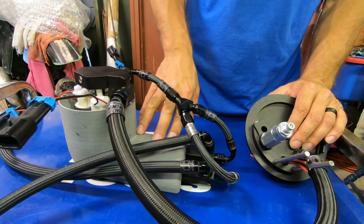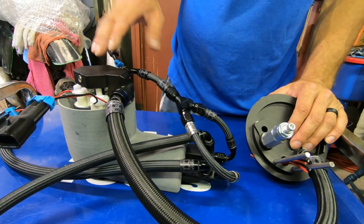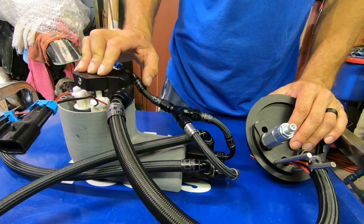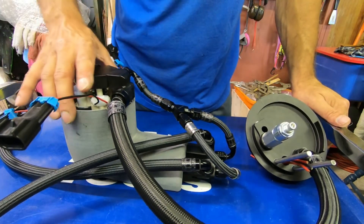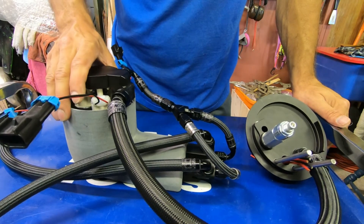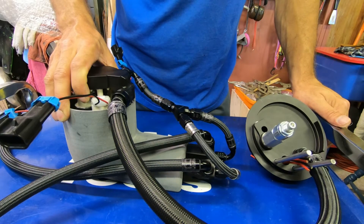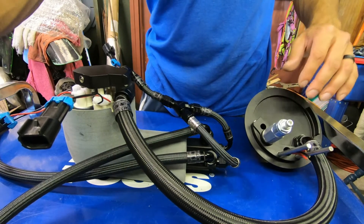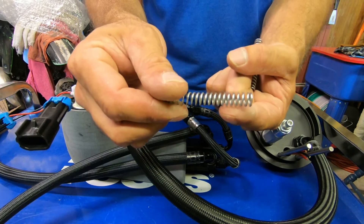You'll see in the functional video — the jet pumps keep the bucket overrunning when all the pumps are at full blast and everywhere in between. That's the beauty of this. Jet pumps incorporated to overrun this bucket — something that's not configured this way with these three pumps is really a packaging issue. What I've come up with here really maximizes the space we can work with in the tank and creates a greater-than-two-liter volume in this bucket to have fuel on hand when you get into the throttle.